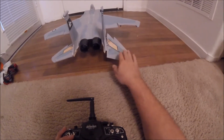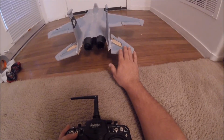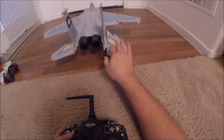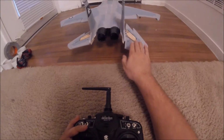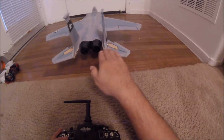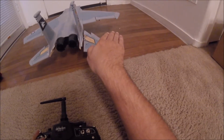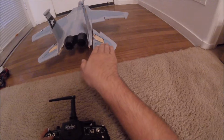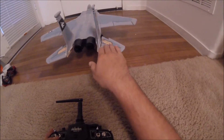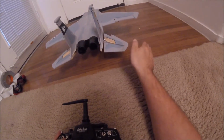What's going to happen is, if they're going to cancel each other out, which is what you want: if this thing tries to roll left so much, and then that wing tries to roll to the right so much, they're going to cancel each other out. But you still have the inputs in the air, so that creates a lot of drag. And what that's going to do is going to be a little confusing. It's going to try to drag that whole side to one side, or it's basically going to create that drag, okay? And then what that does, because rudder does this too, is it actually puts that left wing into the airstream first, and that's actually going to roll slightly to the right, just like a rudder.